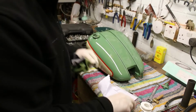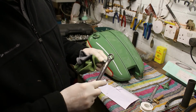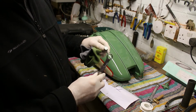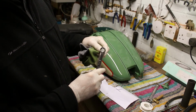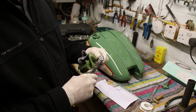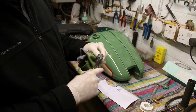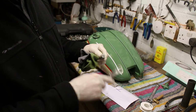And there's always a possibility that it could slip. Now I like these ones, and I read about them in an old book that I got from the library about tools. I know, I'm sad, I got it out of the library. The difference is that these are only 6-point, and when you put them around the nut, I don't know if you can see there, it's got a lot tighter and there's less chance of it slipping when you actually apply some pressure.